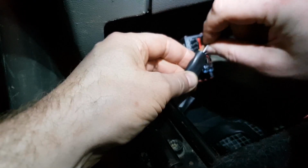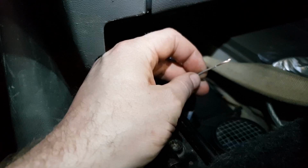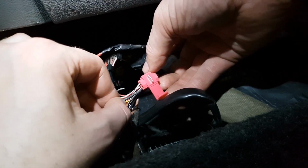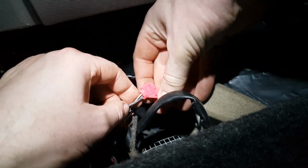Good evening, it's a few days later from when I spoke to you about what I was going to do with the remote thermostat. I've actually been working on the van for about an hour this evening after work, just to finish off that cable to put it in. Quite simple. Right down by the connector I had a grey wire, which was going from the main connector around to the diagnostic connector, not really going anywhere. I've cut that out, joined it onto 1 wire of this sensor. The other wire has gone onto the brown and white down there, which is the wire which also goes to the timer here. Now I didn't cut that wire in half.